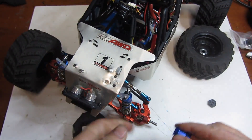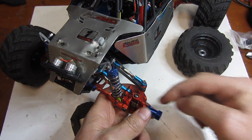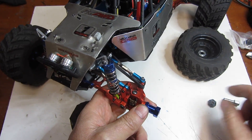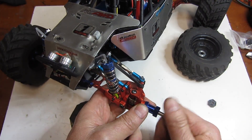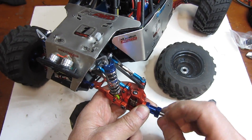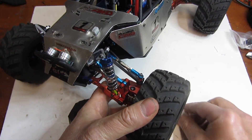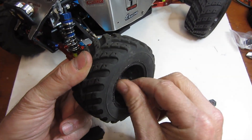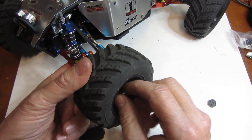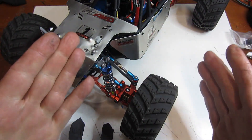Let's talk about how this actually goes together. This piece engages into the wheel. This piece right here is like an extended nut — since the hub extender comes out so far, the threads are up inside here and they don't even stick out, so you couldn't get a regular nut on it. What this piece does is actually go up inside there and engage those threads so you can lock the wheel down. You put your wheel on, lock it into the hub, your nut goes up inside, and then you simply tighten that down until it engages the threads nice and tight.